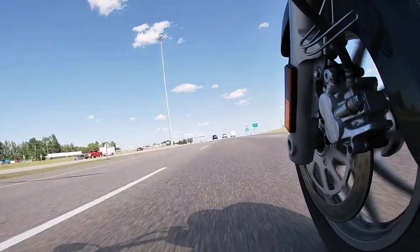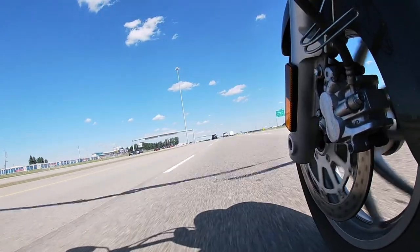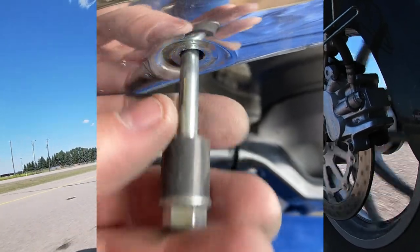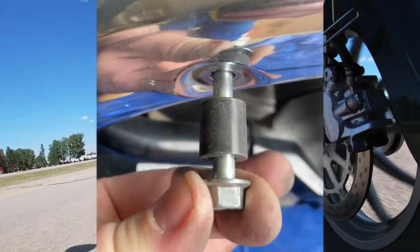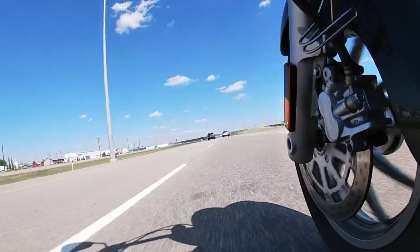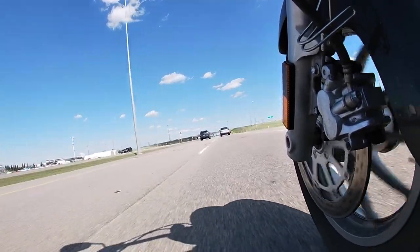To help you remove the bracket, loosen this bolt that I'm pointing at and it'll give you tons of clearance - it'll kind of roll out of the way. Now put the bolts and spacers that were on the vertical walls of the saddlebags back into the holes they were in before and tighten them up. That'll keep these chrome bits that I'm also pointing to from flopping around. With that done the mechanic will have clear access to the tires and wheels, making his life a lot easier - he won't need to remove the saddlebags and that saves you money.